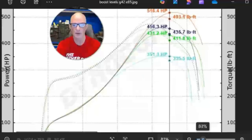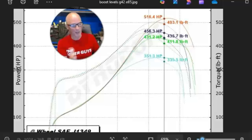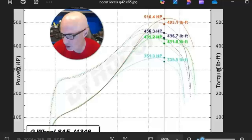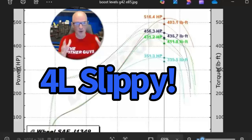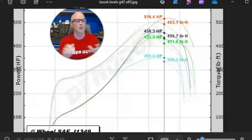Just like with the pump gas, we started out at very low boost and then kept adding boost with our manual controller, going up and up. The goal for the pump gas setup was to make 400 horsepower at the tire, and the goal for E85 was to make over 500 horsepower. This turbo will go to 1,200 horsepower flywheel, so there's a lot more left in it. But we were concerned about our 4L60 transmission and driveshaft speed, which is why we ran it in second gear. It made good power — the kit works, everything worked fantastic.